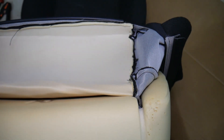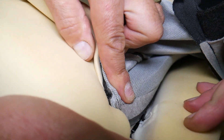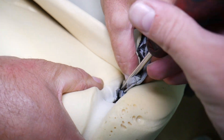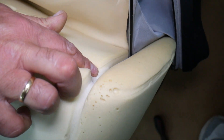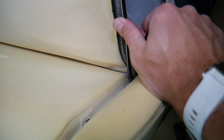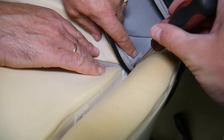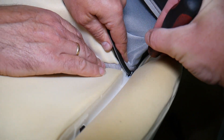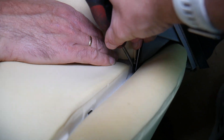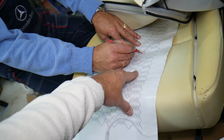On the Tiguan specifically, there's a plastic rail held in by clips. We release the clip on this side, then the other side, and it comes loose. We do the same on the remaining clips — there's one more on this side too. Once all clips are released, we can access the interior of the seat bottom.